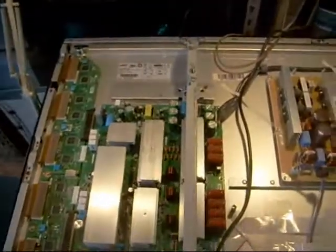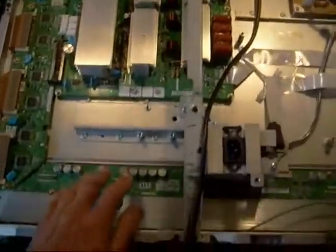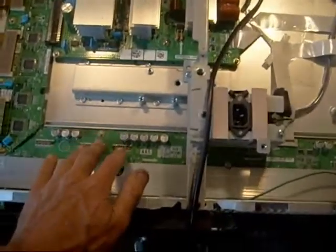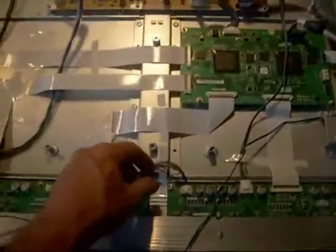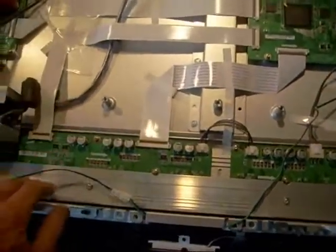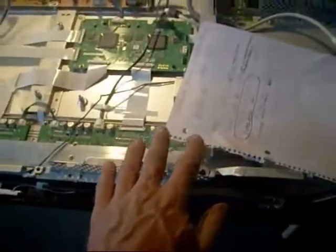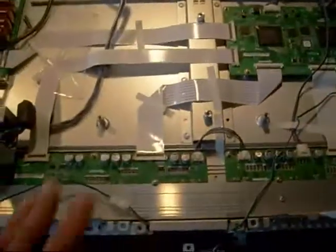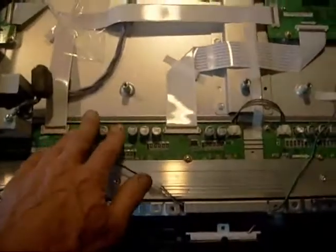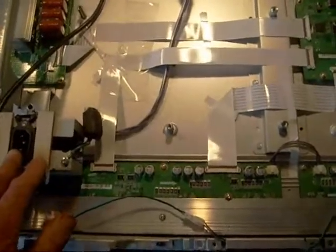Hearing about the 2-inch vertical bar gave me a clue as to where the problem might lie. I started thinking perhaps a shorted X address board — or what Dan calls a C board — this board at the bottom here. Dan used the isolation technique: he unplugged the cable going to the X address board to see if anything would change. When he did, we started getting half a screen, which is better than nothing. So we started thinking this X address board maybe has a short to ground, or perhaps the panel itself has a problem. Panels have been known to go bad and cause various issues.